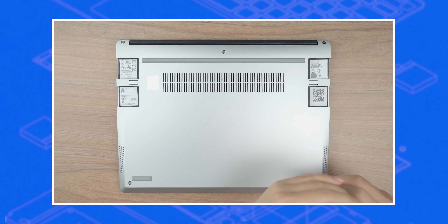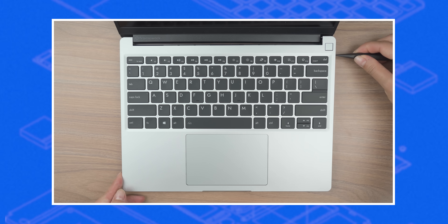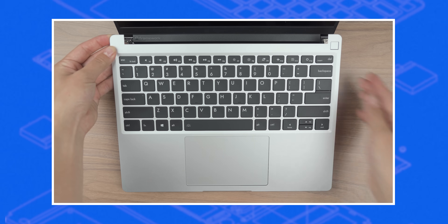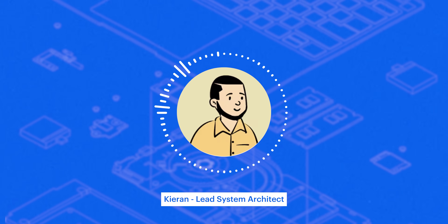The early designs of the expansion card system didn't actually start as expansion cards — in fact, they weren't even USB-C. It started out as something with a similar user experience to our mainboards: turn off your laptop, open up the chassis, and take a screwdriver to it. While that early design and architecture, which would hinge on M.2 interfaces, had its benefits, it had its shortcomings too. As we started centering on USB-C and using the various USB-C alt modes, we found that we could map in each of the types of ports and peripherals that we wanted if we sized it carefully.